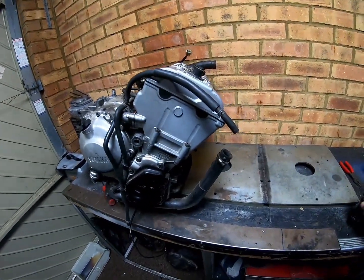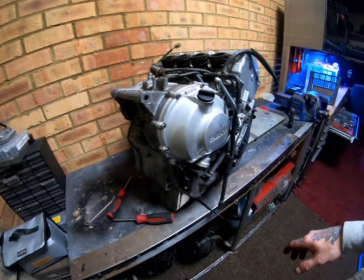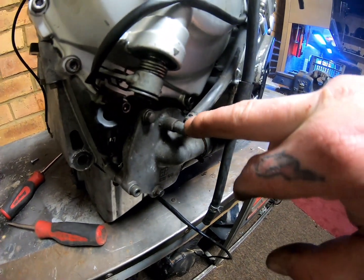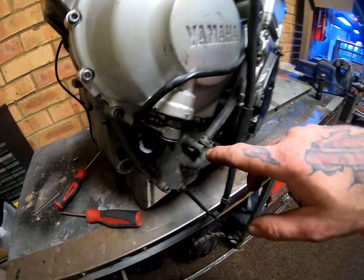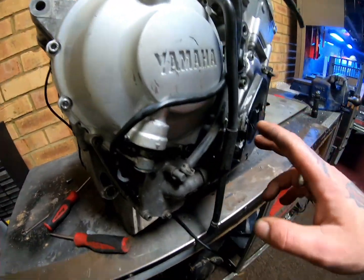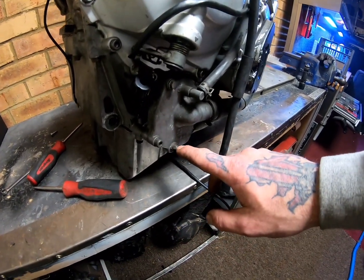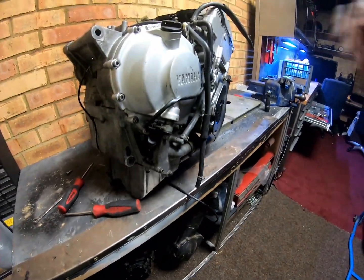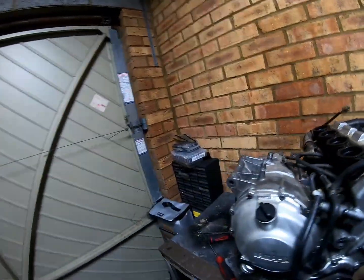So it's a pretty simple cooling system. Doesn't really go wrong unless you've got a leaking radiator. These parts here on the pump can leak on the EBs, but they are modified on the 5SL. So if you do ever get a leaking one, just get a 5SL pump or pump cover, and have that replaced. You'll have that problem rectified. That's the drain for the cooling system. So undo that, water comes flying out of there. Pretty simple stuff really. So that's it.